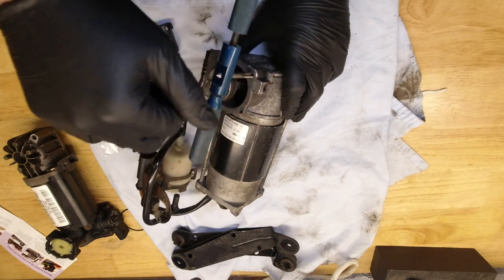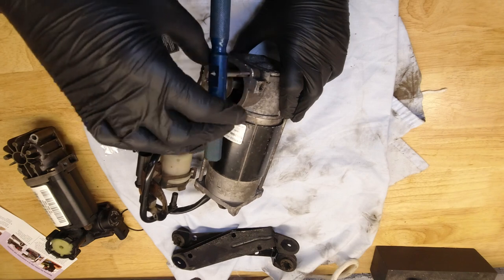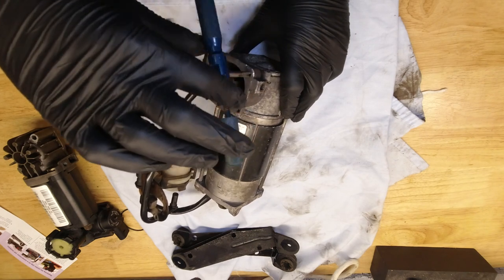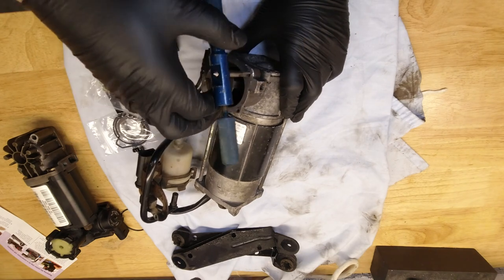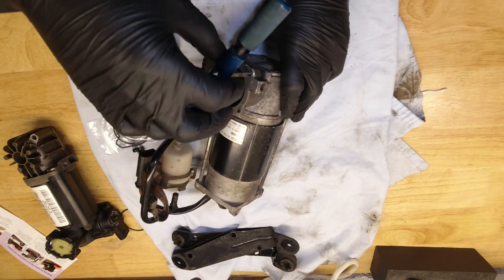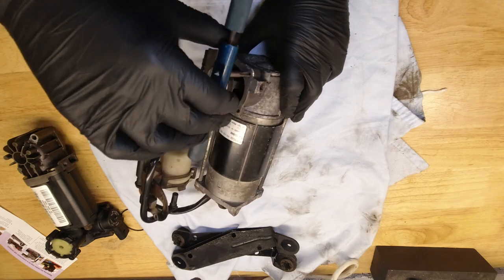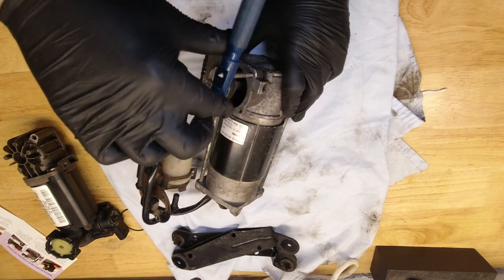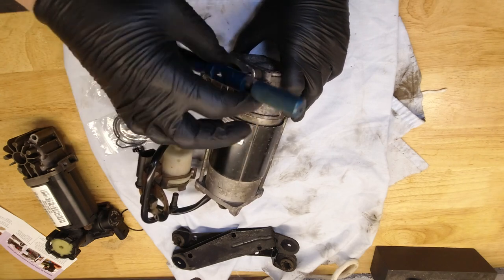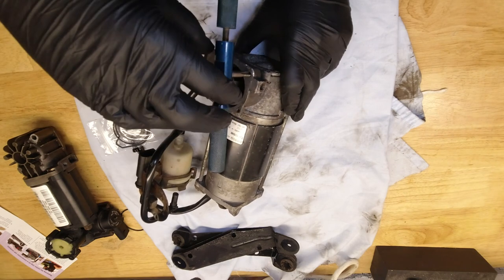This tap wrench is something I made when I was an apprentice. Although in aluminium you're not going to get too much of a problem. Remember, turn it forward one, back a couple. Just keep breaking off the swarf. Don't let it build up. But as we're cleaning the thread rather than cutting it, and it's aluminium, you shouldn't really get too much of a problem.